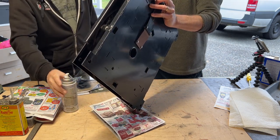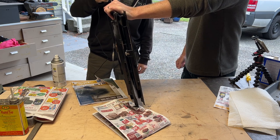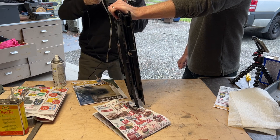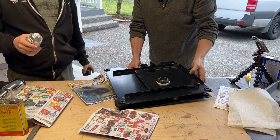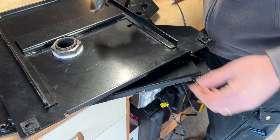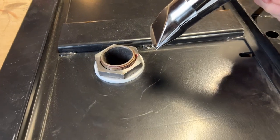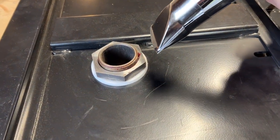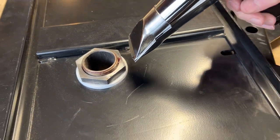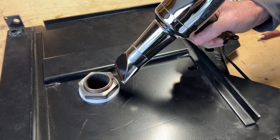Since it's cold out, we're using a heat gun to warm things up a bit — it's winter in the Pacific Northwest. We're all done except we decided to put some thread locker on here, because we don't want this nut to work its way loose and come off while we're driving down the road. Thread locker applied, and hitting it with the heat gun to warm it up.